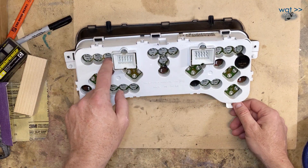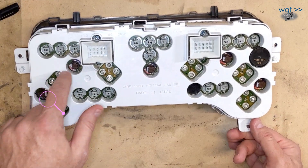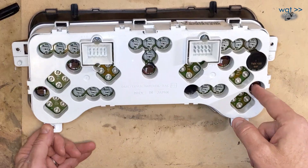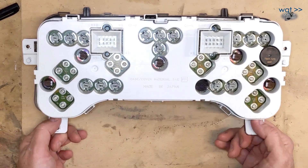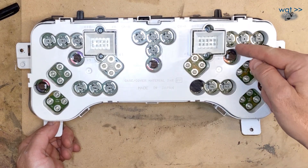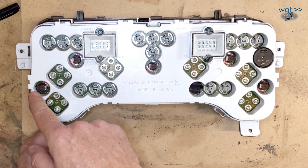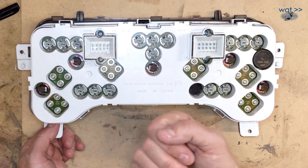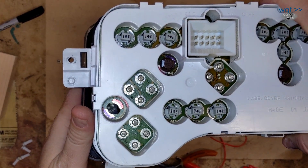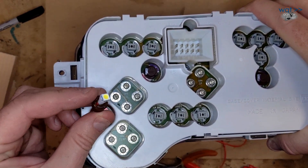There are a whole lot of small indicator lights you could replace, but I'm not going to mess with those since I don't have any that aren't working. What I do have is five sockets responsible for lighting, and I've previously LED-converted these — although one's gone bad again. When I did that I went ahead and labeled positive and negative on all of them. Four go one direction, but this one randomly goes the other — I don't know why. There's a light diffuser down inside there, then two terminals that make contact with little brass pins. All five are in. The only one missing is for the ABS warning light — this Jeep doesn't have ABS so I removed that entirely to reuse the socket elsewhere.